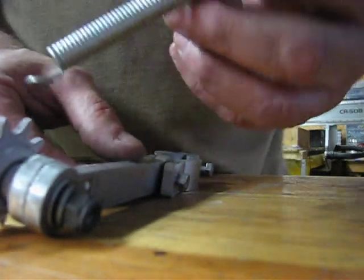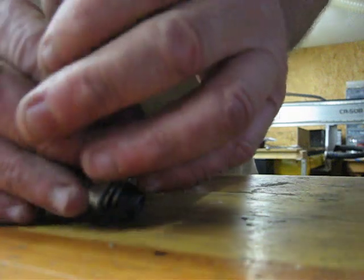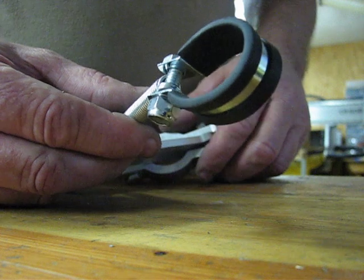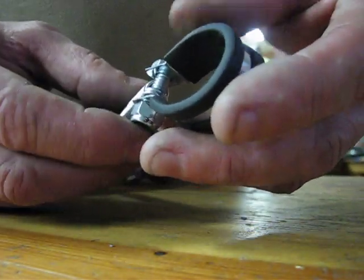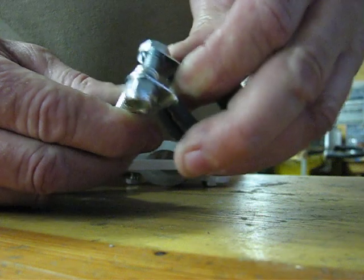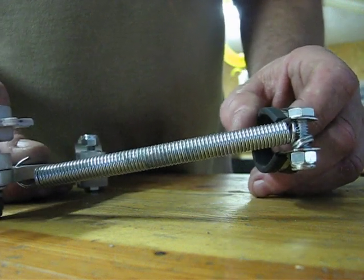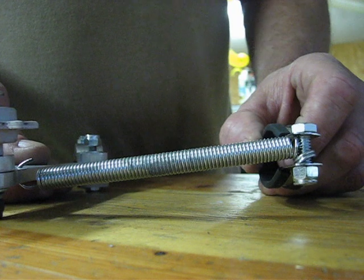With the spring setup, hook your spring in and that goes up to the upper drop tube. There's a nice rubber bracket right here that allows you to put it on your frame without scratching it, and that goes on the upper tube for the rear drop. Tighten and snug it up, but allow a little bit of slack for the spring to move somewhat. The spring is pretty long to allow for a lot of different bikes — you may have to cut it, but it won't be too short. On a lot of bikes it just goes right on there.